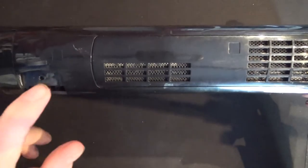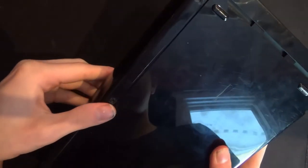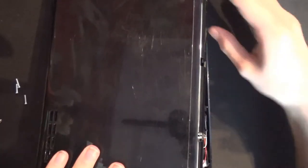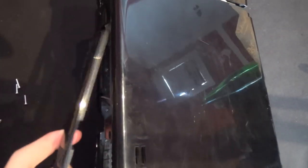After you remove the ones there and there, let's start in the back here. Here's how this panel slides to the left and then pops off. There are no more screws under there yet, but there are three tri-heads along the side. Begin removing, lifting up like so. This side piece comes out, as well as the fan grill.